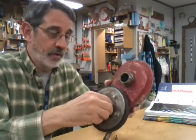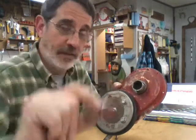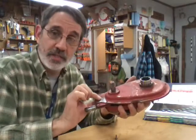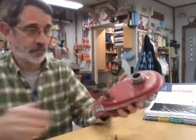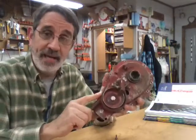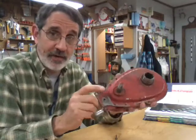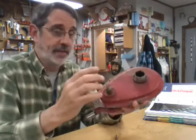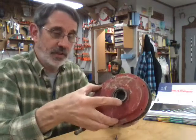The big nut in the center — take that off. There are two washers in here, they're cupped like a bowl — put the cup side up. Pull your clutch assembly off, then there are 10 screws around the outside. This style has a real band brake that grabs a brake drum, more or less like your car's. To open the case, take a flat-bladed screwdriver, tap it into the crack, and work it around — twisting so you don't bend your case. That cork gasket really seals, but they just slide right off.